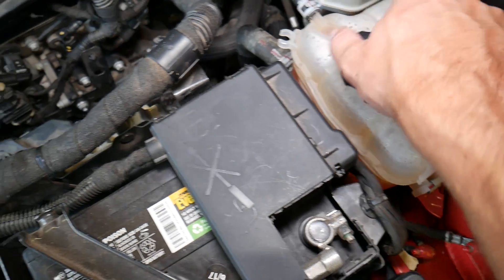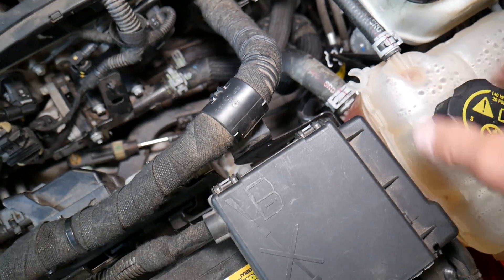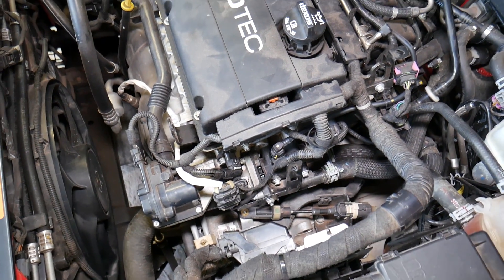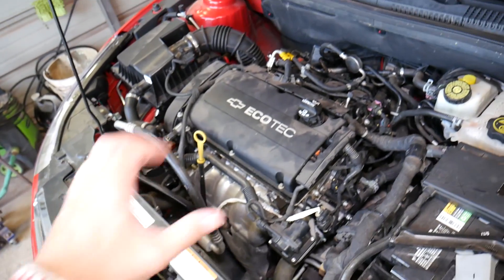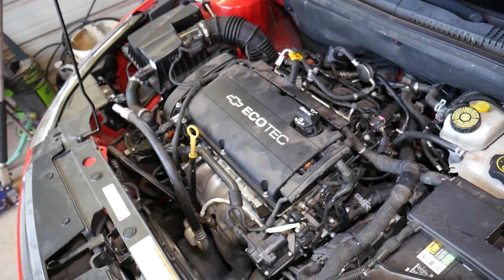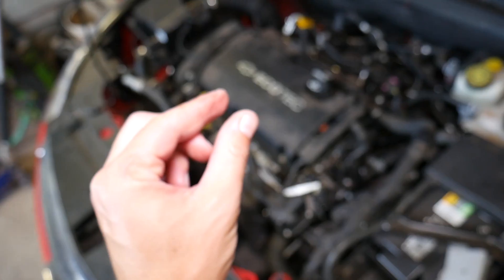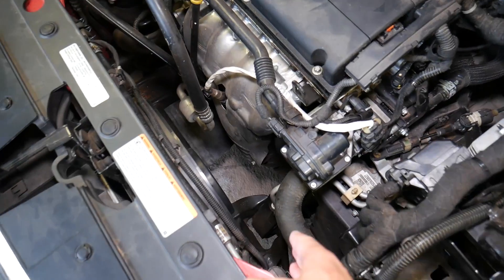If the cap doesn't open at 20 PSI and you have too much pressure in the hoses, it's probably a bad cap — so replace the cap. But let's say you put a new cap and you still build pressure in the hoses and see bubbles. Most likely you have a bad head gasket, because the head gasket is blown and some blow-by gas makes its way into the cooling system — the passages are less than half an inch away from each other — and it pumps air into the cooling system, creating pressure in the hoses.